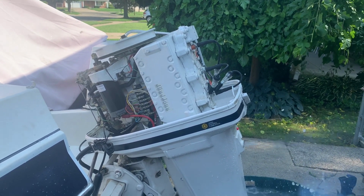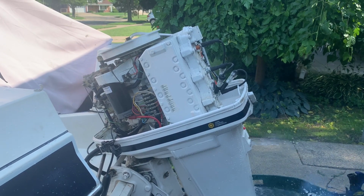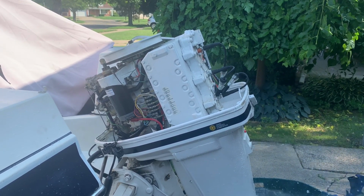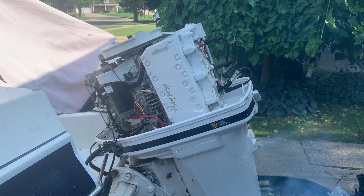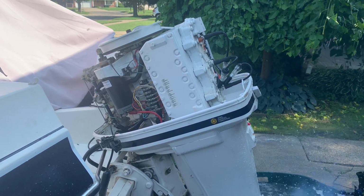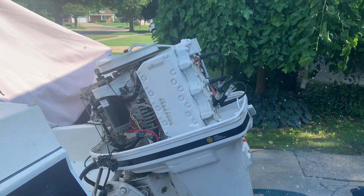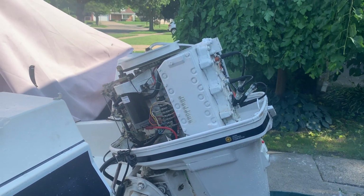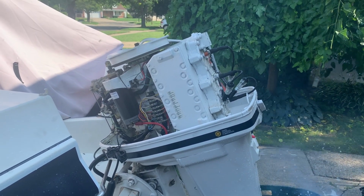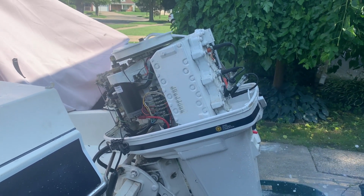Somebody had tried to fix that with maybe liquid electrical tape or some other kind of material they painted over the wires, but they eventually got exposed. I think they were grounding to the block. So I took them off, I wrapped them in real electrical tape, and they're insulated now. So that's the fix. So thanks for watching.